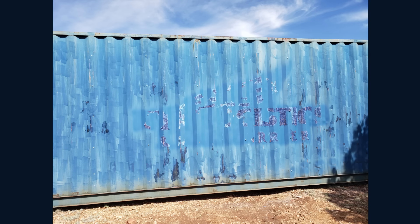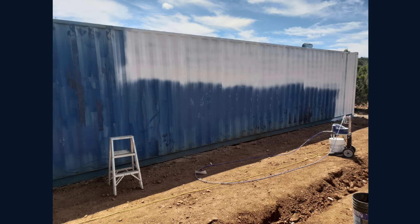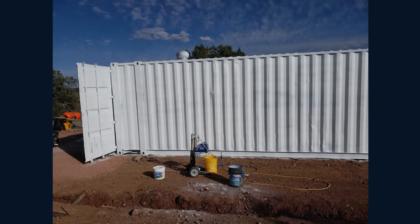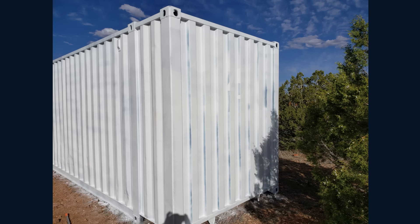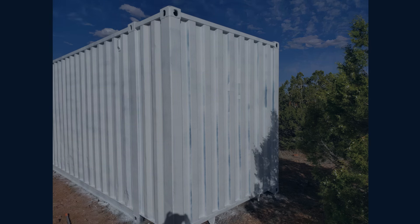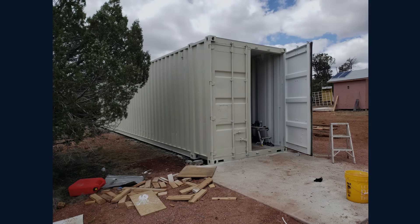When it came time to clean the exterior for paint, I discovered the 4000 PSI pressure washer could not remove the decals unless using the zero-degree nozzle. An angle grinder with a wire brush ended up being most effective but still left glue residue behind. In the end, it was best to just paint over the decals, as had been done by previous owners. The airless sprayer made applying the primer and paint easy; however, the Tropical silicone reflective roof coating was too thick and had to be applied by hand.